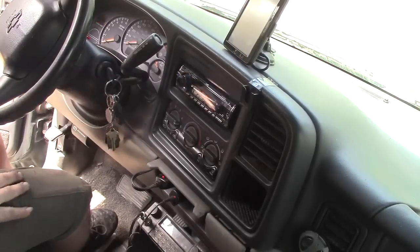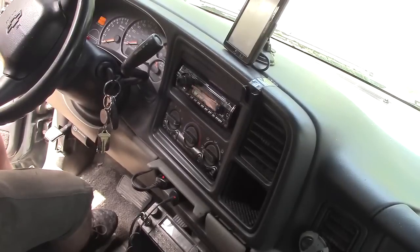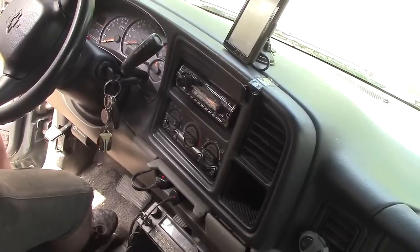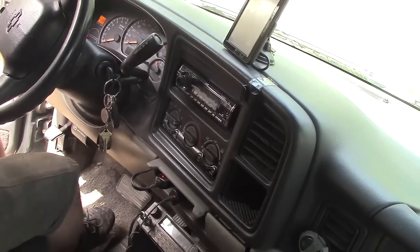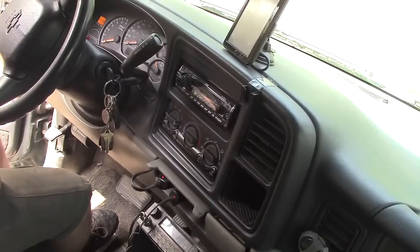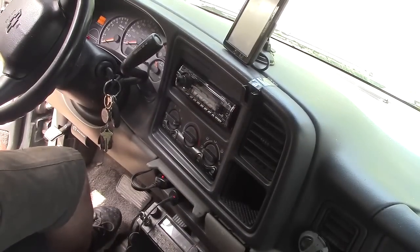Hush. If you don't have a parking brake, you might want to get a block of wood. And I know just about any parking brake, if you don't use it constantly, the cables are going to seize up, and these GM trucks have particularly weak parking brakes because they're combining a small drum with discs, and rather than lock the caliper down, they decide to have a little drum, and it's basically spring pressure only. You can't put direct cable pressure on it. So I'm just going to sit here and hold the brakes until I get to the point where I can put it back in park.